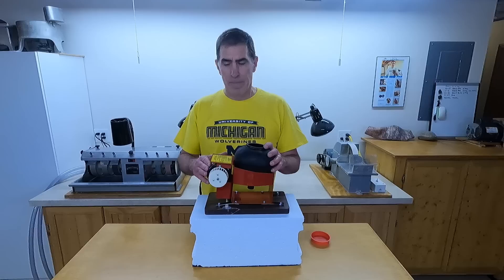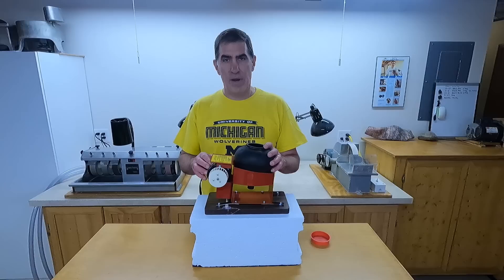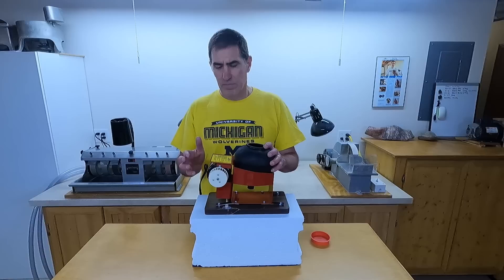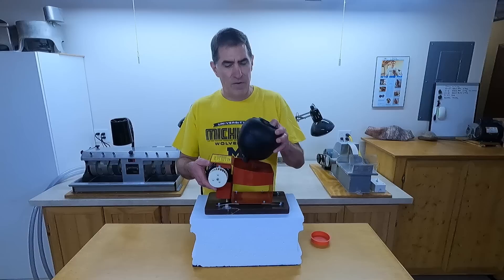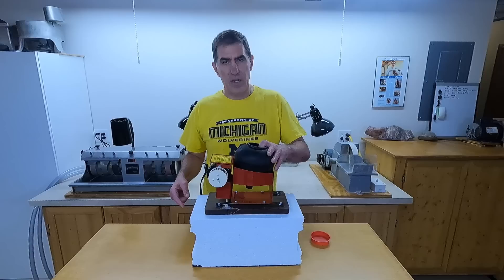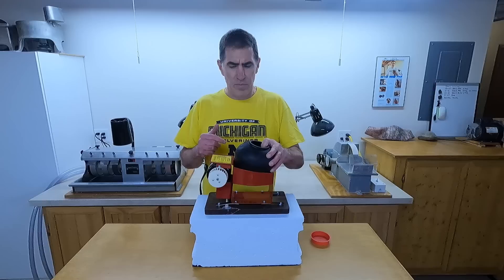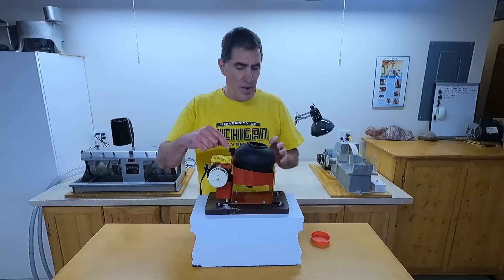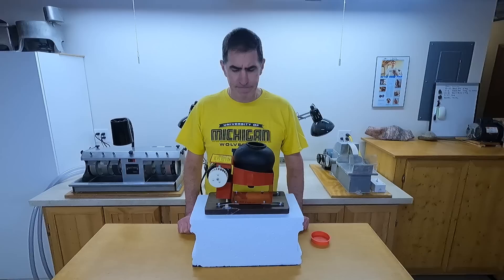I will say that my motor after 10 years burnt out and I had to get a new motor on my other one. As the motor got older the bearings were going bad — it went from a hum to more of a buzz, a less pleasant and slightly louder sound. I also had to replace the barrel on my other one because it got too thin from the inside, it squished too much and would slip down and bottom out. You don't want it all the way down — just put it in so it's snug. If your rocks aren't tumbling well, you might have the barrel in too far. One person fixed this by jamming a piece of cardboard in between.